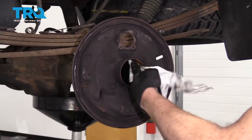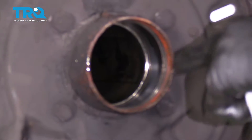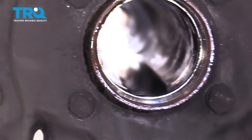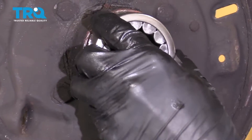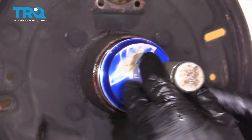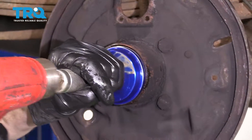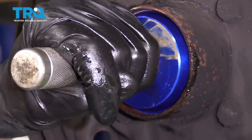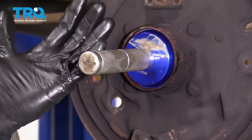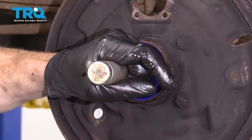Let's go ahead and clean out this area. Take a double quick look inside there — make sure you don't have any of those bearings rattling around. Once you've done that, go ahead and grab your brand new bearing. Let's start it in just like that, and then we're gonna help it along with one of these installer tools and push it in. Definitely heard an audible difference in sound there — that's letting me know that I made it to the point where it's bottomed out. Let's go ahead and get this out of here.